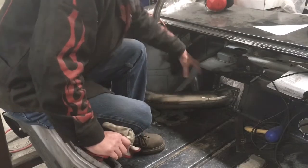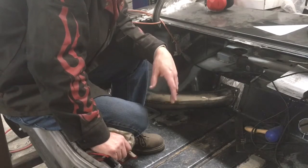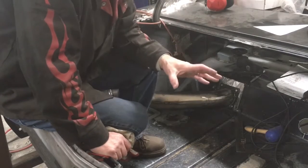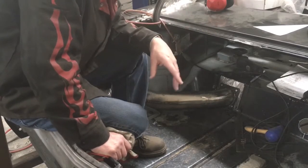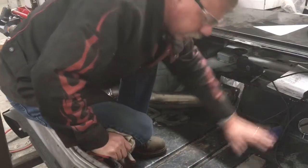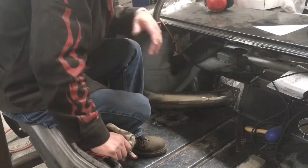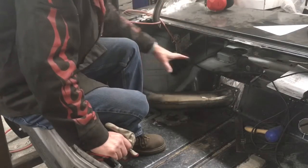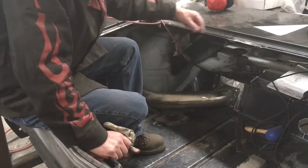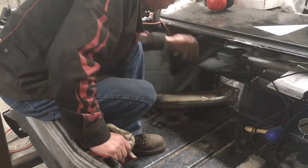So I'm going to grind the welds. The whole thing's going to get a powder coat that is rated for exhaust tubing and headers and that kind of stuff. And then there's a flange on the other side and the exhaust to tie in. So now, to make the trunk usable and to provide one more protection, we were already planning to put a shelf in here so that the floor would be at this height all the way back. So first, I'm going to build a framework that comes around this and level with the top here, and the frame will get welded in, but then the panels will all be screwed in, and then they will be sealed so that any moisture or exhaust fumes or anything would be dumped outside.